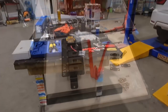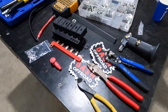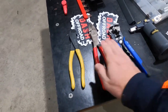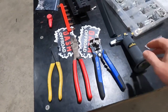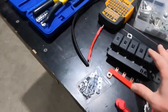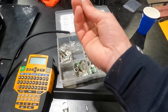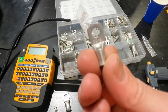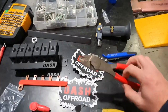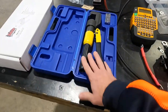That's what comes in the kit — now let's show you how to assemble it. If you're going to do this at home yourself and want it to look like a 4x4 DNA setup, here's what you'll need: wire strippers, wire cutters, crimpers, a blowtorch or cigarette lighter for heat shrink, lugs — the little 10-6s work really well. If you've got bigger cable you'll need bigger lugs, and for bigger cable you're also going to need a hydraulic crimper.